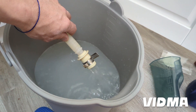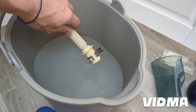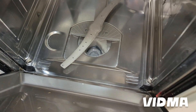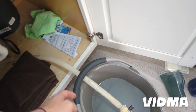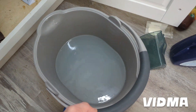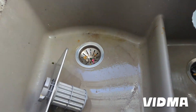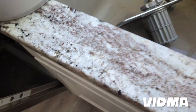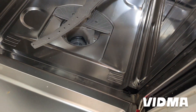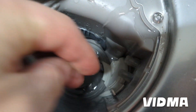I've actually been taking them apart with the water still in them when I can't drain it — you can shove the water back out of it. There you go, empty as it can be. It worked this time, but that doesn't mean it's going to work in the future. Maybe there's something in the pump or in the line. A piece of glass could be an issue — especially if a wine glass broke. Some glass can get through the filter and sit in the bottom of the sump, so be very careful if you're sticking your fingers in there.